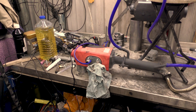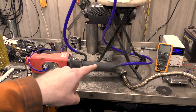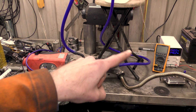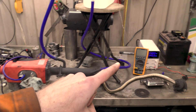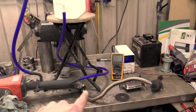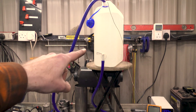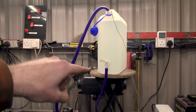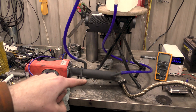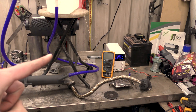We are running now. So we have the diesel heater, we have the EGR cooler — that is the outlet pipe that goes up to the tank and that is the inlet pipe that comes in from the bottom of the tank. We've got the thermocouple on the multimeter, power supply, and I just put the exhaust pipe in to try and make the sound go that way. That is our 10-litre water tank — there's the bottom hose, there's the top hose going back in the top. It's now running. Now let's turn on the thermocouple and see what the temperature is.